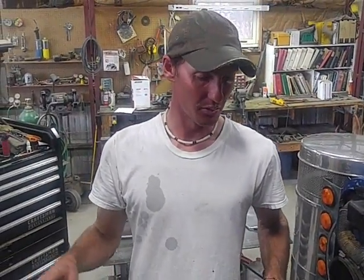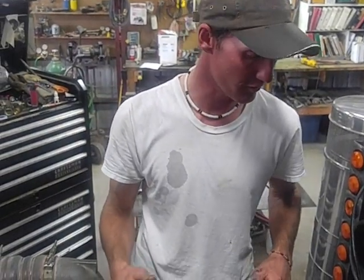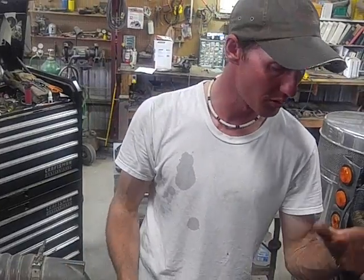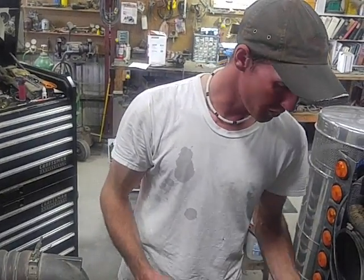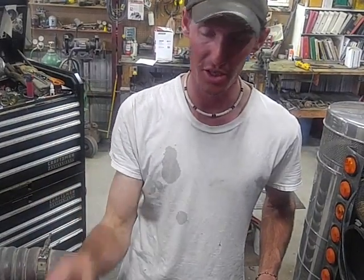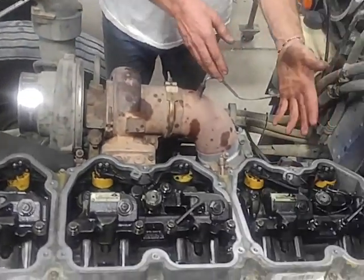Now, when you're all done, once you roll it over, because obviously you have to do one side, roll it over, you do the other side. We're on 6 now. Pull your pin, roll the dampener over 360 degrees, get on number 1, do it all over again. You're going to do the exact opposite of what you already did.